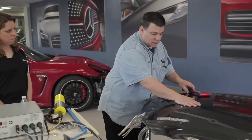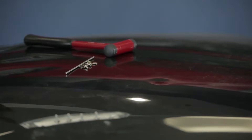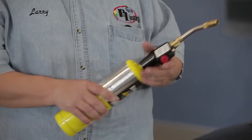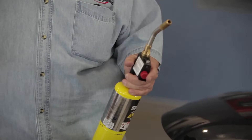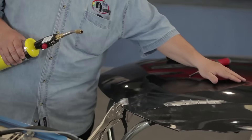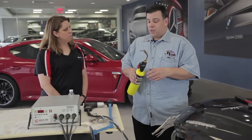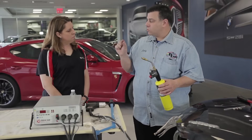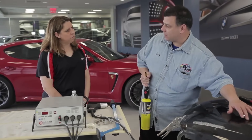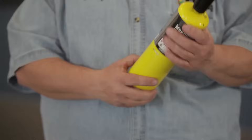Normally in class I'll get some of these panels and make a dent. That's a fairly large dent I just put there. Another school of thought is to heat it first and try to remove it without any pins welded on. You'll be very surprised how fast this aluminum panel will move when you start heating it. You can have a non-contact thermometer while applying heat. Some people talk about induction heaters, but the problem is we can't get a small enough tip to really get into the center and work your way out and back in again.